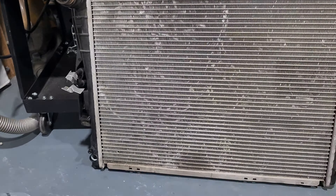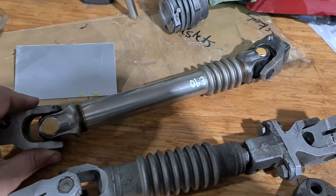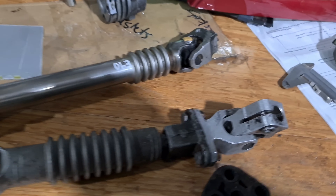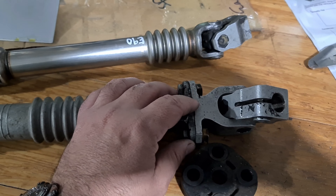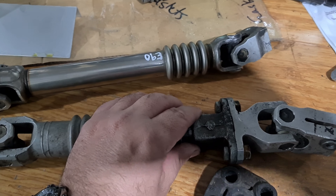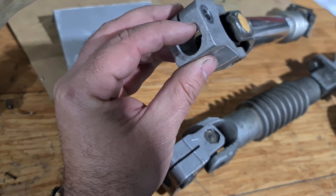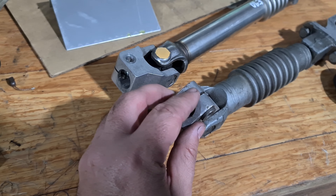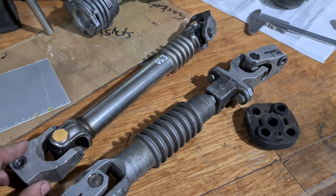My wife specified she said I need to get a Mishimoto or a Koyo because she doesn't want this thing to overheat. So I'm going to try and make the thermo fan fit this, then fit the evaporator and the power steering cooling lines, and then we can put it in the car. I also got my E90 steering shaft in the mail. The reason I needed it is because I didn't have enough clearance when I made the headers - it fouled on the pipes with the heat wrap on. However, this end is 18 millimeters whereas the E46s have 17mm, so I'm going to have to swap the splines over. Then I'll have steering in the car.